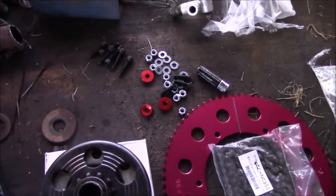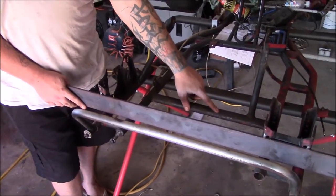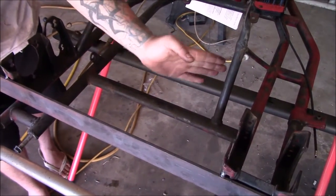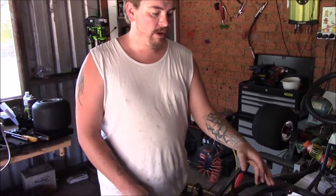We're doing one of the final and biggest mods on the Cali cart so we can finally set up the rear axle properly and run a chain. We've stripped it all down — took the axle out, took the seat out, took the motor off. Now I've got to cut the back half of the frame and replace a pipe with one that has a bend in it so the sprocket clears that part of the frame, otherwise it would just hit.